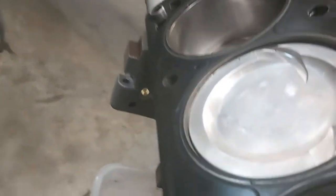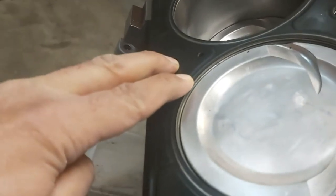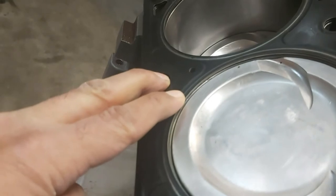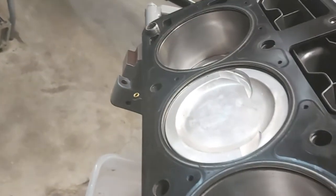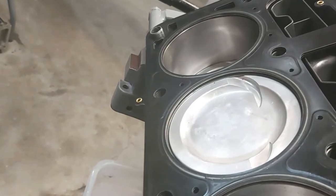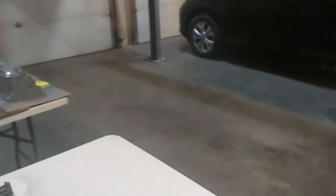On number six you can see there's a nice big step — when you push down on it you've got a good step there. I measured it and it's about 50-thou, which is fine because the number everybody agrees on is 40-thou minimum. So we're at 50, we get a little bit of rock, and this piston was also sticking up about 6-thou above deck. I think we're going to be good.